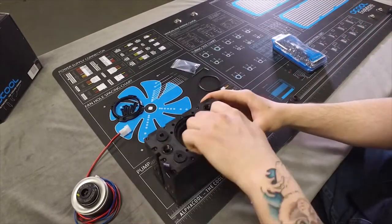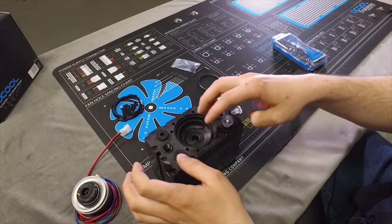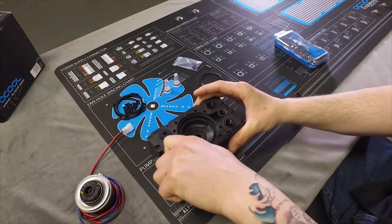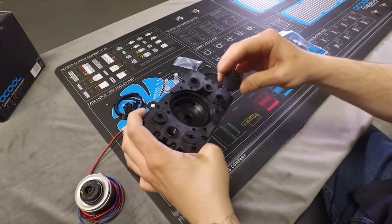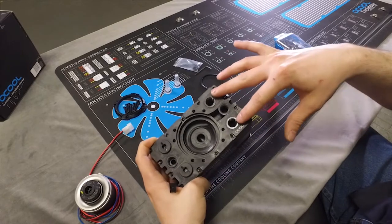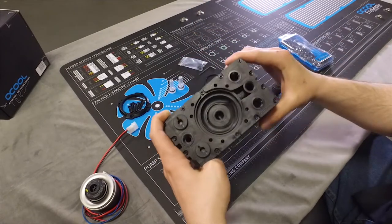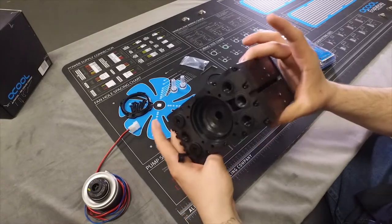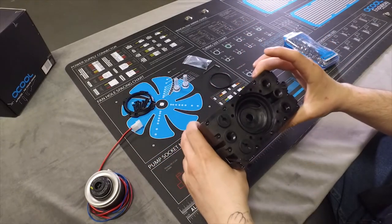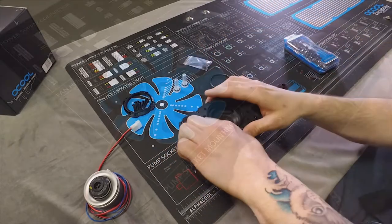I'm going to take the bottom plug out now — using my hands, finger-tight. About 90% of the stuff should be finger-tight; you really shouldn't need big wrenches to keep your loop from leaking. Just to confirm, all three of those holes are G1/4. You could plug the two light ports if you wanted, but these probably light up really nicely. I'll actually be showing that in another video where we put this exact pump/res combo into a build — so we'll probably keep the LEDs in, but I just wanted to take it apart to have a look.